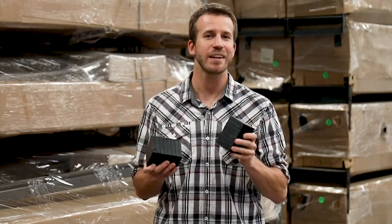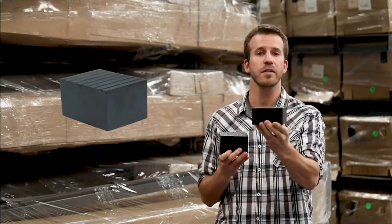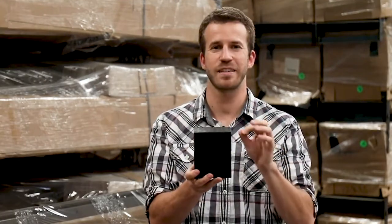So, when you slide a QuickJack frame under the lift points, you have a few options with how you stack the rubber lift blocks. You can use the short block for a low stance car, the tall block by itself, or the short and the tall block together to get the full 21 inches of rise. However, this only makes sense if there's a little bit of space between the blocks and the lift point.